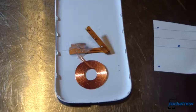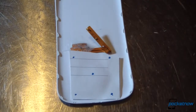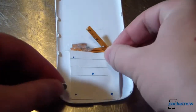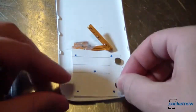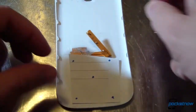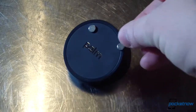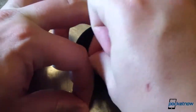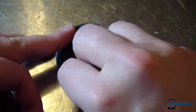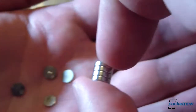We'll drop our paper template over the coil to give us position information for our magnets. If you're worried about messing up the phone's compass with magnetic fields, you should use the metal discs we pried from the Pixie. We're using magnets in this example, so we'll be sure to check the polarity to make sure we're putting them down in an attractive — not a repulsive — attitude. You can check polarity and positioning on the Touchstone itself. Do this repeatedly as you're taping the magnets in to make sure the alignment is good. Also, very important: make sure the magnets aren't too thick, otherwise you'll never get the battery door back on the phone.